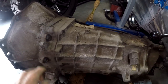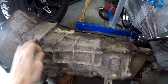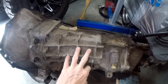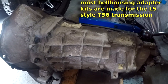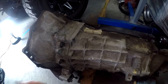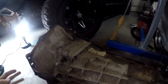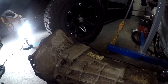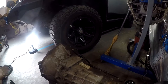I've already cleaned the surface area of the front plate - the mid plate. This RTV sealant came loose, so you'll need RTV sealant between the plates if you're doing the same thing I'm doing - converting your LT1 transmission to LS1 style so it bolts onto LS engines. Since I'm putting in a different input shaft, my input shaft isn't coming with a replacement bearing, so I'll be ordering a new bearing and shims.